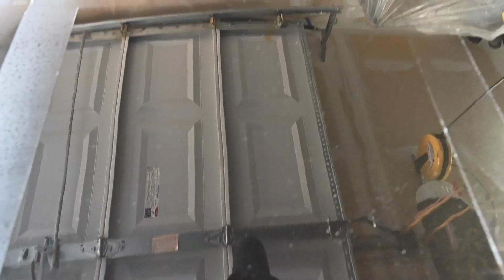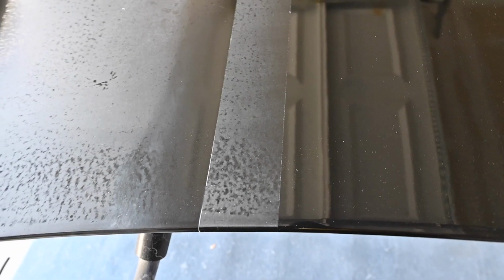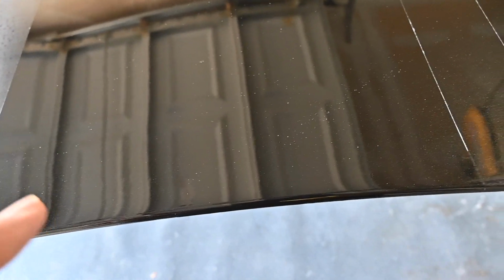So this is now compounded and polished, and there are basically no sanding marks and virtually no swirling marks. I'm going to go over it again when I do everything, but I'm very happy with the way that it came out. You can see the difference: this is just sanded, this is now sanded, compounded and polished, sorry about that. And over here you can see the original spot that I tried to compound and polish. It came out a little bit all right, and then this side over here you can see all the haziness and everything still in it.